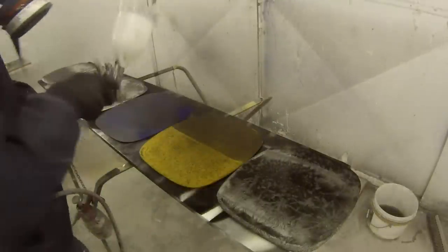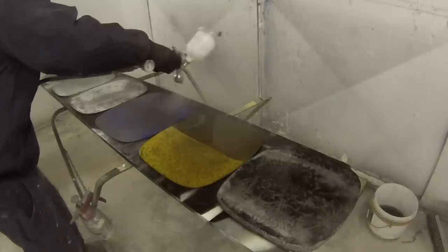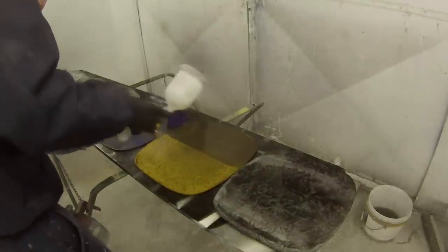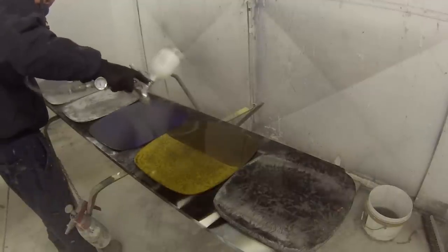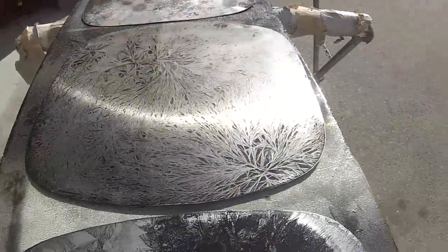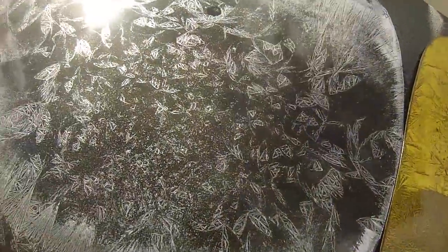I can't see any reason why you couldn't also do it over a piece of wood — if you had some nice wood grain you could put some clear over that, put your crystals down, and then clear over the top for a pretty unique and cool looking effect. Next up I'm just putting a couple of coats of clear on. No need to wipe it down with wax and grease remover — some of those products actually remove base coat. You're better off giving it a good clean down with a nice clean rag after the water, using your air duster gun to blow all the water off, then a good tack cloth, and a couple of coats of 2K clear. Because you don't really get enough build-up of the black to create an edge, you don't really need to flow coat it — as long as you get it nice and clean you should have a good result with the first couple of coats of clear.